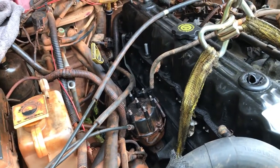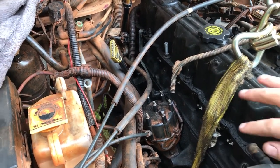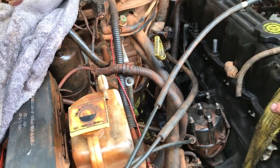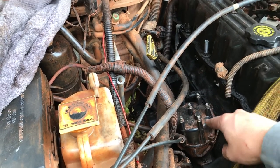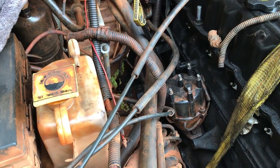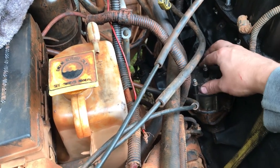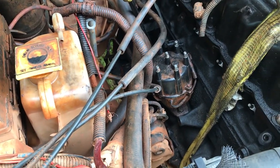So on a WJ 4-liter out of the 2002 WJ, they have a long rail here with coil packs. And there is no distributor. I had to add this distributor off of the old motor. I will have to pull it, unseat it a little bit. It's kind of loose. I left it loose a little bit.